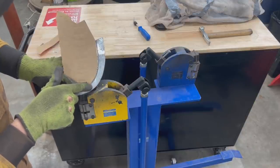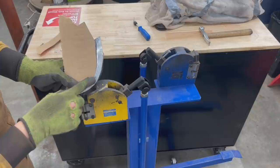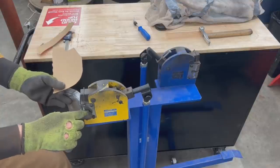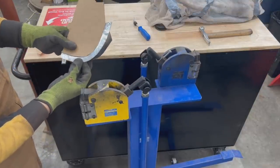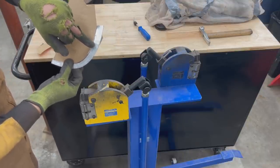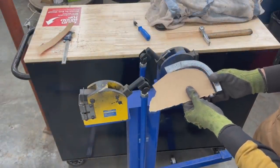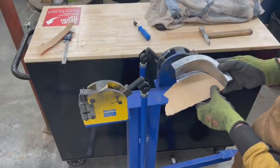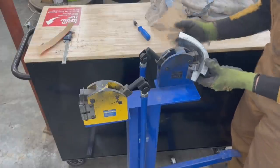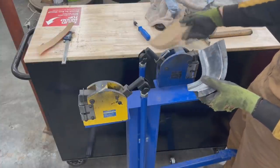So I'm gonna do the stretching part first and then we're gonna shrink there because I'm on the stretcher. So it's gonna become even more overlapped. So I'm gonna stretch here. And now we're good all the way to here, and now we're gonna shrink here, and it's gonna come back. Okay, so this side is good. Let's see this side. And it's pretty darn close, so I would check it on the car.